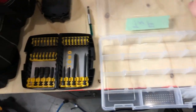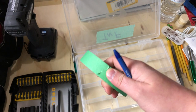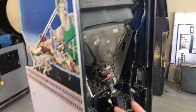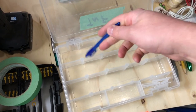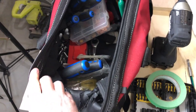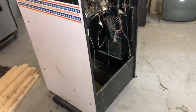One of the things that I like to do when restoring a game during teardown is take one of these little plastic bins. As you pull parts off the game, you take little pieces of masking tape and a pen, and you label these little bins with where the screws, bolts, nuts, and whatnot from the cabinet came out of. That way, when you go back and put everything together, you can find the same hardware, clean it individually, or replace it as needed. That's a tool we're going to use, along with my general toolkit for repairing — screwdrivers, ratchet sets, and all that kind of stuff.